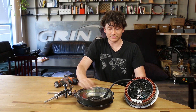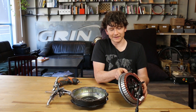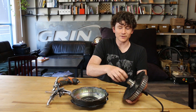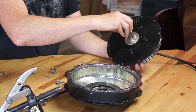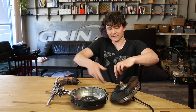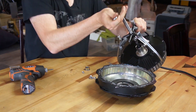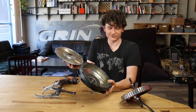Now we can tease these two items apart. We've removed the stator and one of the side plates. If you want to service the side plate itself, you remove it from the axle as well — that's also done with the gear puller. Once again, remove the hardware and install the gear puller on the side cover pressing against the center of the axle.